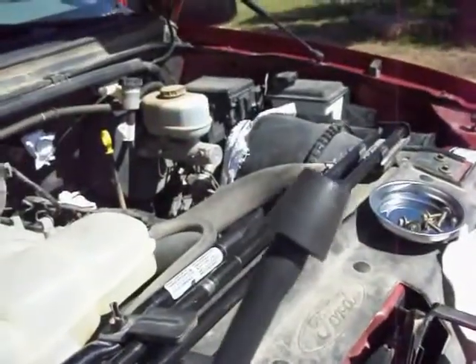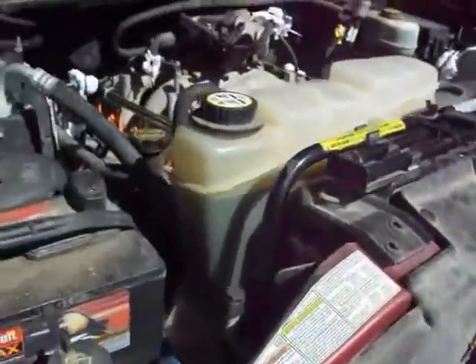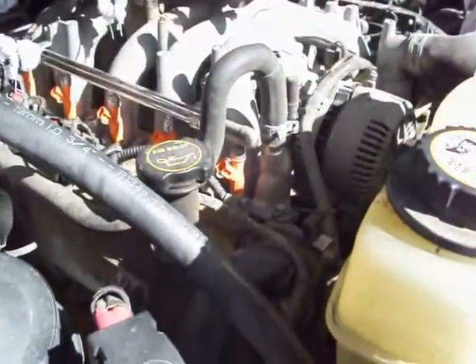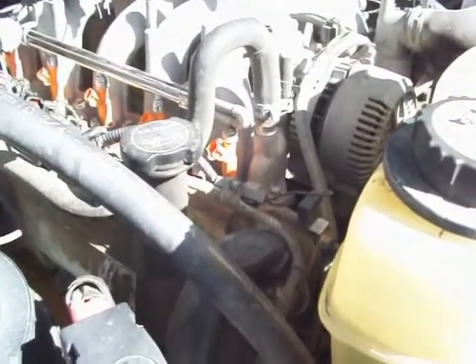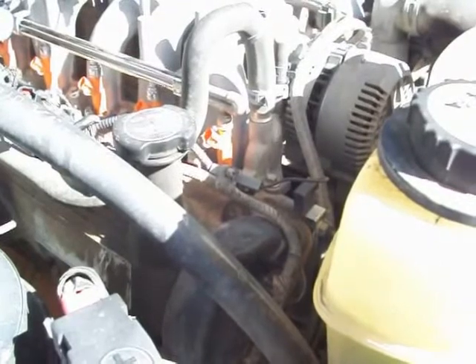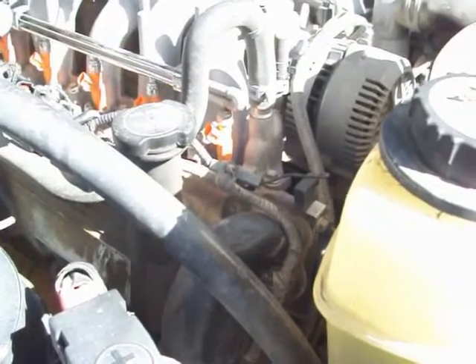We get a little air pressure in there and the plug pops out of the spark plug hole. The question was: where is the cylinder in the four strokes? The four cycles are intake, compression, power, and exhaust. During exhaust and intake the valves will be open. During compression the valves will be closed, with the piston going up. Then the piston goes down during power and up again for exhaust.